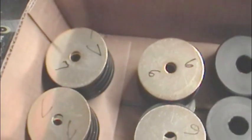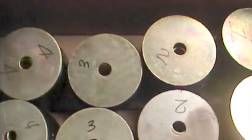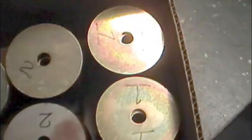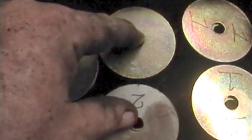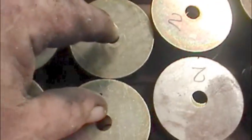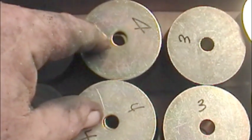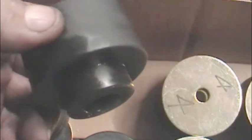So here would be everything in its proper order — I'm pretty sure I got it right. All you need to do is look on the instruction pamphlet. There are basically four different numbers — uppers and lowers — and arrange those. Here would be the core support: that's the number one position. Two would be behind the front wheels. The ones I just showed you would be the number three position. The ones just in front of the rear wheels would be position four.